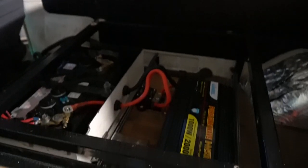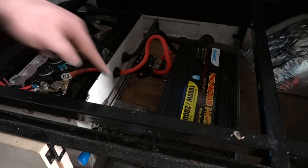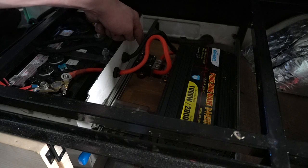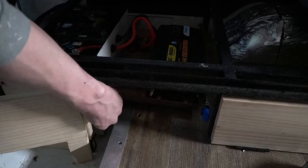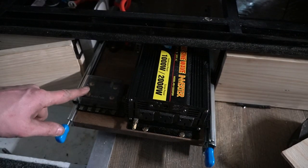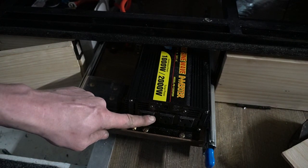So this is how the basic setup is going to be. I've got it all right next to the battery. There's the 12 volt fuse box here, a breaker there at the back, and the inverter here. But with the wooden panel on top, that's going to be inaccessible, I hear you cry. But that's what we'd like you to think. That'll give you easy access to the fuses and any of the inverter plugs, if you need to — but hopefully, you won't.